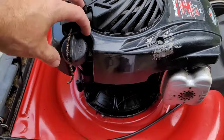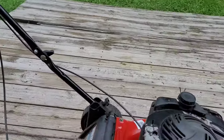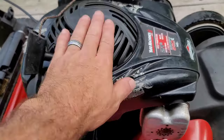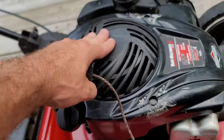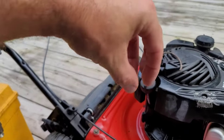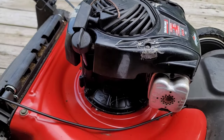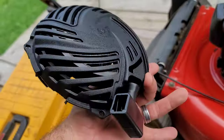The only other issue was the pull start - obviously it's all the way down here, not up where it's supposed to be, because they broke the pull start on it. I went ahead and restrung it temporarily with some paracord and was able to get it running. You have to hold down on here as you're pulling it for it to engage, because the recoil cup was all jacked up - the spring was busted. I rewound everything just enough to get it running, then went ahead and ordered a new recoil setup from Amazon for about $20.